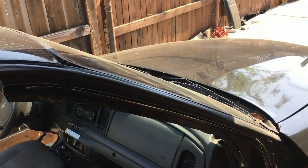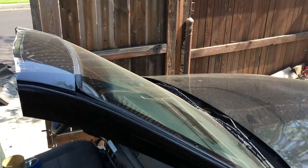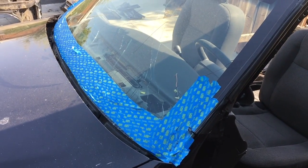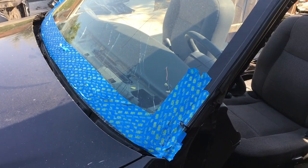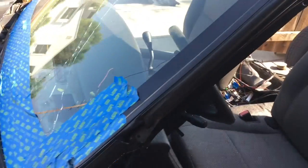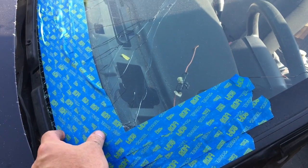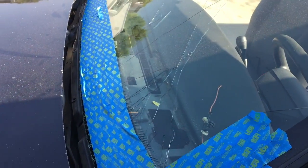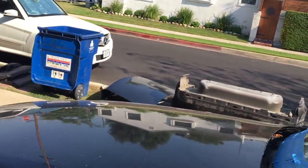So now, windshield time. So I'm going to spin around, start hacking the front. As you can see here, I've covered the bottom of the windshield in tape just to try and hold a bit of glass in place if I can. And then obviously the Sikaflex, the bonding agent, is probably about that deep on these. So I hit it with a lump hammer all the way along to just break the glass up. Then cut through this side. Lighting's terrible. There we go. Do the other side.